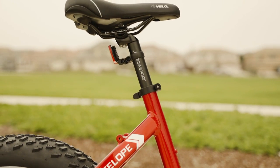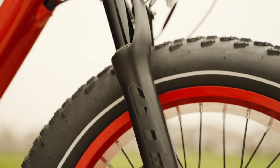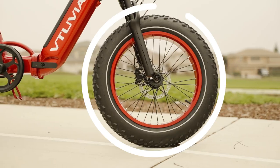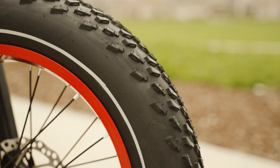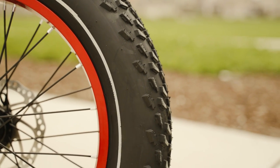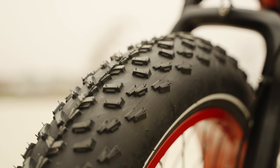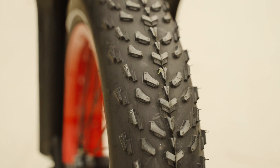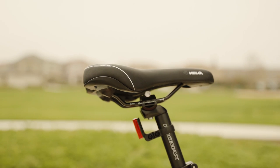The Antelope has front suspension — a nice bonus on a bike like this. The front forks have about 60mm of travel with a lockout option. Paired with the fat 20-by-4-inch tires, this creates a pretty smooth riding experience. The Anova tires are rated at 60 threads per inch, which strikes a nice balance of ride comfort, durability, and tubeless reliability — popular for gravel and mountain biking. They're on par with industry-standard tires, if not a step above, and feature sidewall reflective stripes for nighttime safety.